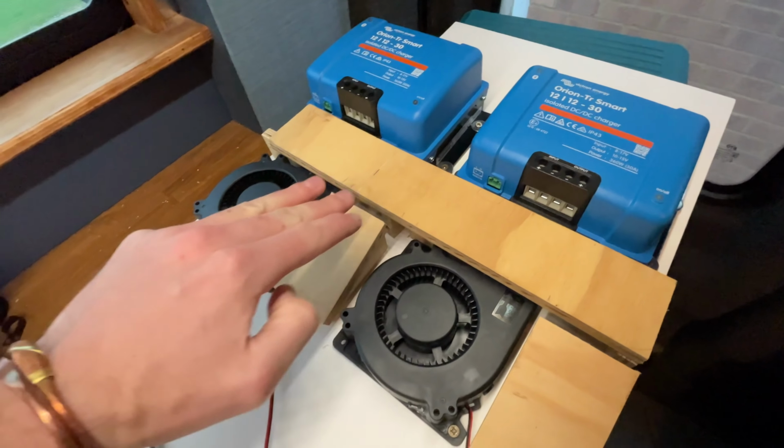On the negative cables, I'm going to do the same. I'm just going to take one of the bolts and pins out and stack the 50mm and the two 16mm on one, and then put the case back on. Additionally, it's going to be quite neat in the cupboard because these are all stackable like so. So I can just have the four big 50mm cables going in, and then eight in total 16mm coming out, which would then enter the board and go up to the appropriate area. I think that's going to be a cheaper solution than buying all individual posts and studs.